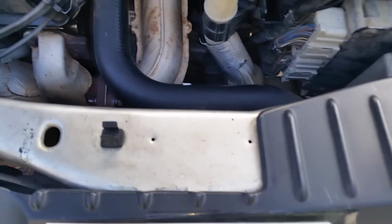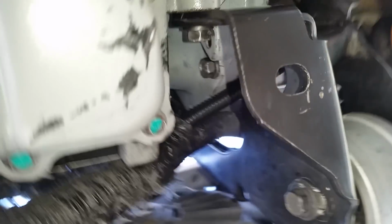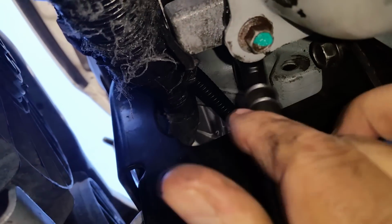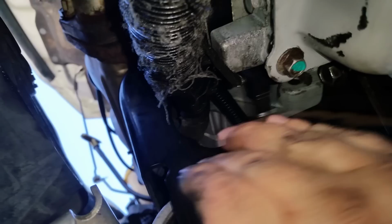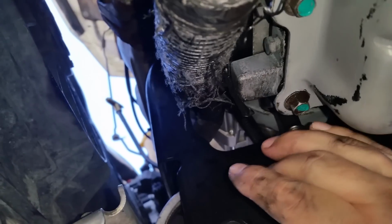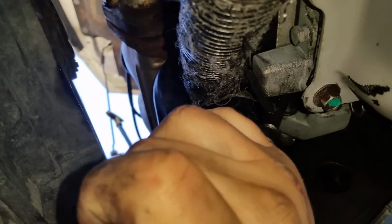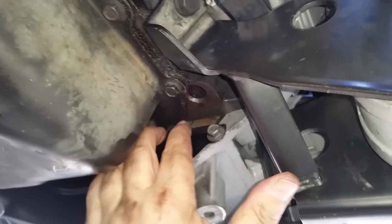All right, all we have to do now is tighten the one up on the bottom. We're gonna come back around over to here, and we're gonna tighten that bolt up right up there. You'll need your short 15mm socket and your ratchet. There she goes. She's pretty much tightened up. Don't over tighten it, because that starter right there, it's just aluminum, so be careful.